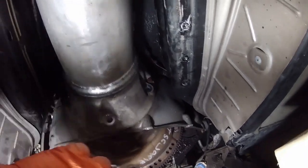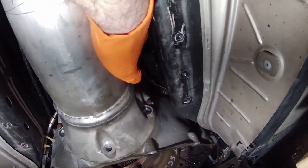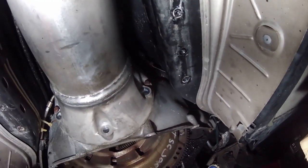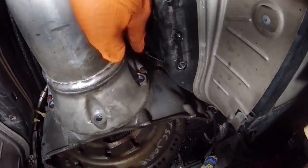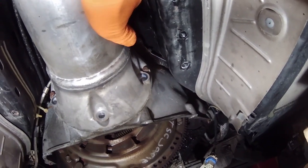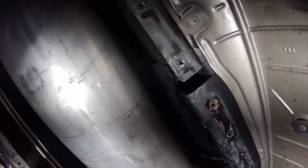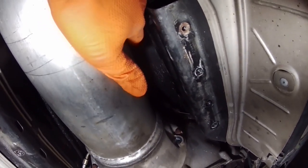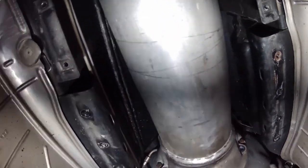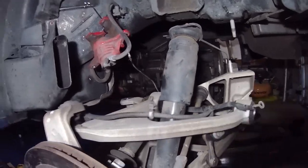Another thing you'll have to do is, you see this wiring harness up here? The clip's on top of the torque tube, so what you want to do is stick your hand up here, push the wiring harness off towards the driver's door, and then it should pop itself out of these clips. There's like four clips on the top of the torque tube to hold that in. So just push that to the side so you don't pull on that wiring harness as you lower the torque tube out. All right, I was able to get the mufflers off,